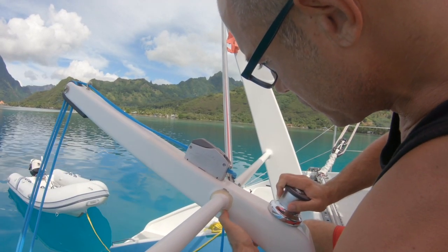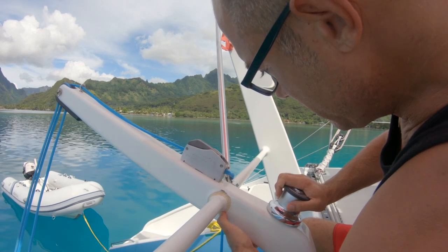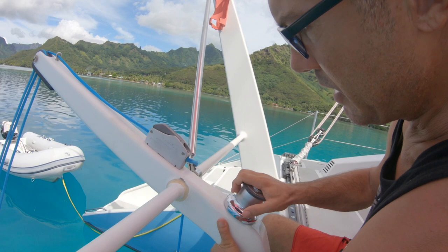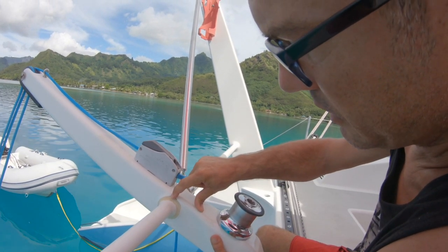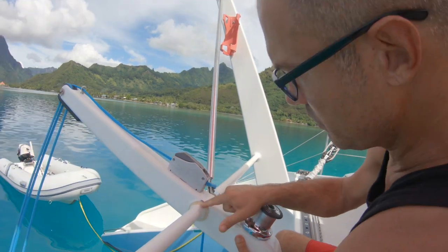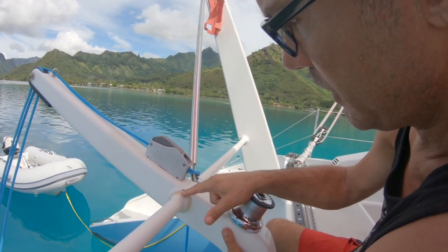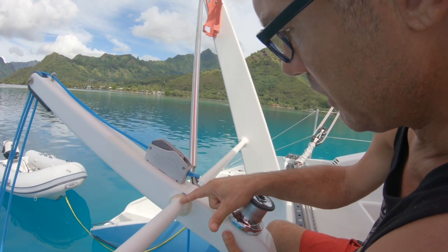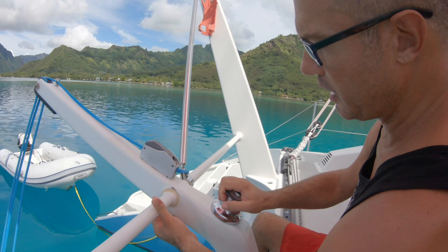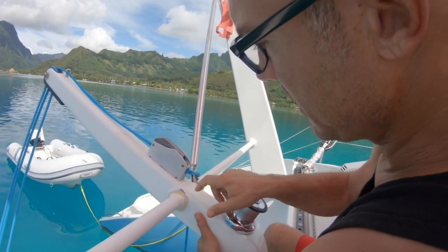Take it down until I do not see the crack anymore. This crack goes all the way, so the main thing is you've got to be careful not to cut in because this is glassed. Don't take away any of the glass on this. Basically you're mainly trying to take down the crack itself, and then a little bit of the fillet where it goes into the pole. It's just going to be a mechanical bond — not going to be as strong as the original, but it should be much stronger than it is now.